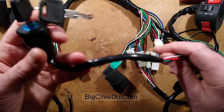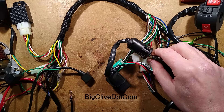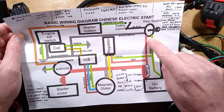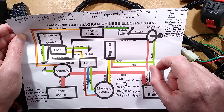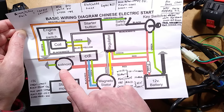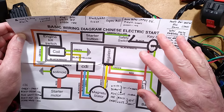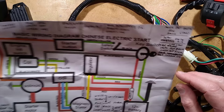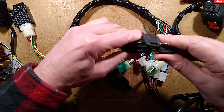We'll start with the key switch. The key switch starts by switching power to the system. I have reverse engineered stuff here; here's a little picture I've found on the internet. The key switch has a positive and negative going to it. Noting that green in this system is chassis, black is actually switched positive, which then goes through a safety switch to green and yellow, and then to red and yellow to go to the solenoid. The key switch does two things: it switches power to the bike in general, but it also has a shunt contact. It shunts the black and white wire to chassis to basically disable the engine completely — which is quite dramatic, as I'll cover in a moment.